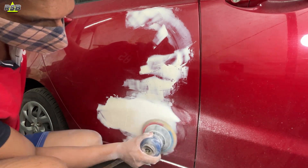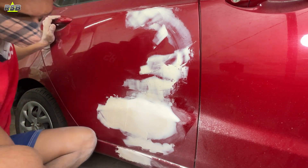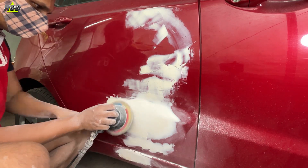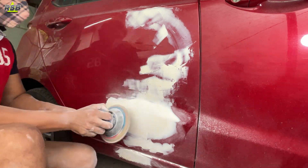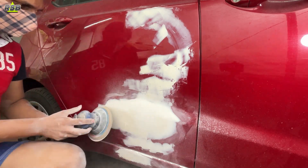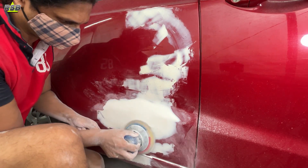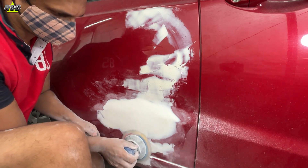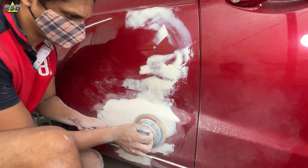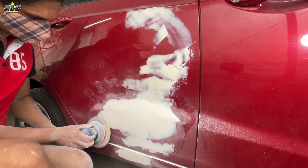Because once you apply the base coat and clear coat, you should not be able to tell that you applied body filler or did body work here. This body filler is applied to level any imperfections or ups and downs in the panel. I used a stud welder to take the panel out, so there were lots of imperfections. You use body filler to level the panel, all the body lines, and shape any curves. I am still sanding the same spot where my major dent is — I have not started sanding the top or bottom yet. Sand and finish one spot first before moving on to the next.